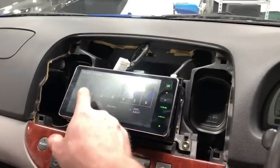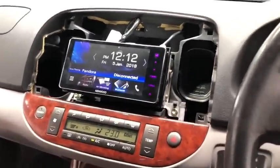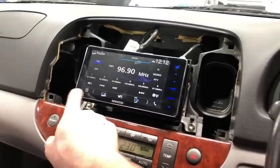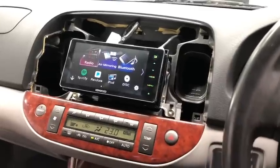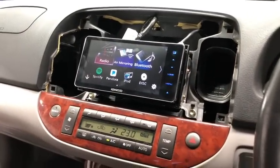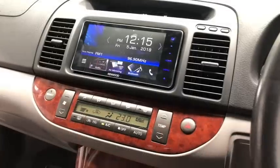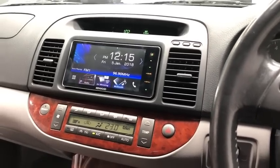The units are adjustable angle for the camera, so if you get glare you can adjust. CD/DVD is behind the screen — really cool. These aren't available in the US or UK, only Australasia and Asia for Kenwood, though they have shipped overseas and they do work. These have dual USBs which will run MP4 and WMV files, so put DVDs into digital media and it'll work. That's the finished product — the Kenwood DDX 917 in a Toyota Camry 2005-2006 with Apple CarPlay, Android Auto — a half-hour install.